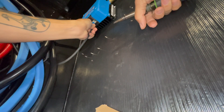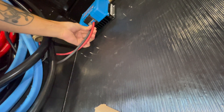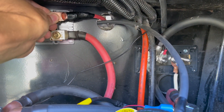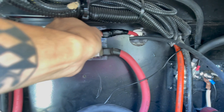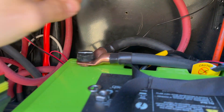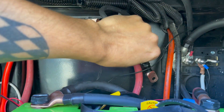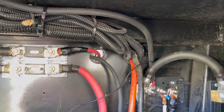I've got my positive and negative fed through — let's go ahead and get them connected to the charger. Those are nice and tight, not going anywhere. Now let's connect them to the other side and run our input wires from the harness. The positive wire connects here at the fuse block, which then goes down into my bus bar. That bus bar comes right from the main battery — my main positive connection where the inverter and everything is connected. Let's get the negative tightened down and move on to the next step.